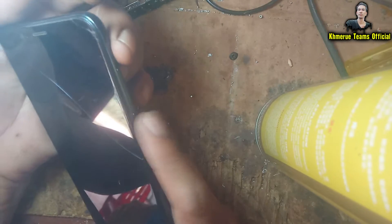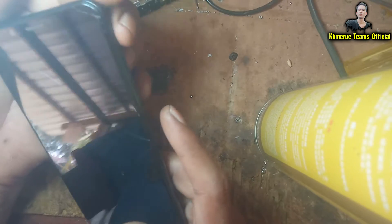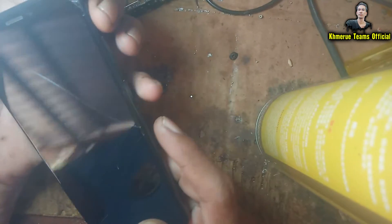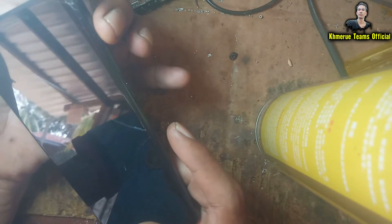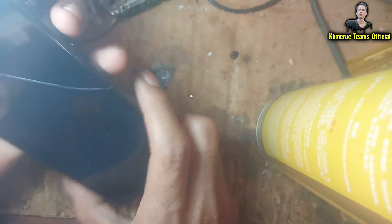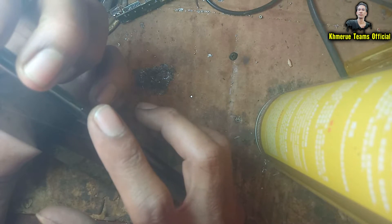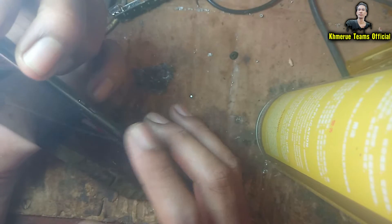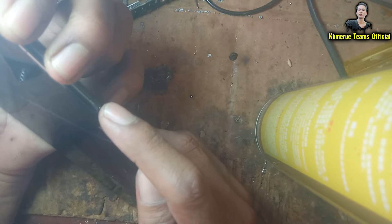When the phone is completely off, you need to hold the volume up button and the power button at the same time. We are not trying to turn on normally — we need to press both at the same time when the phone is starting up. Hold the volume up first, keep holding it, and then press the power button.